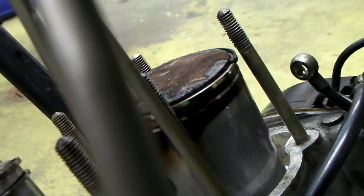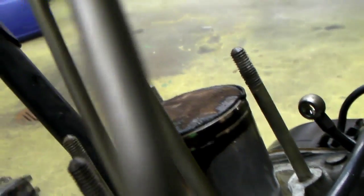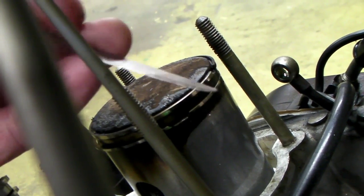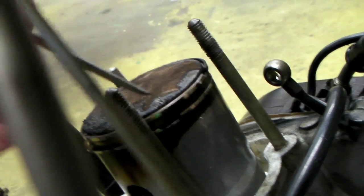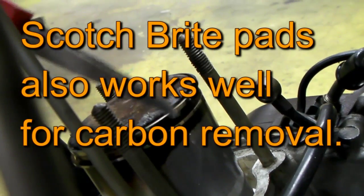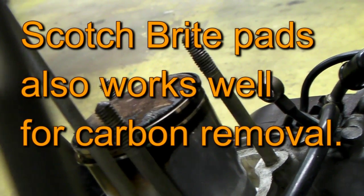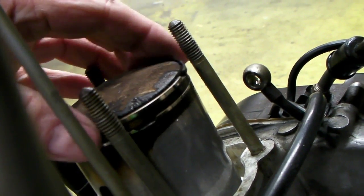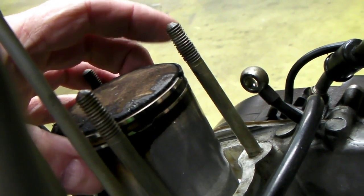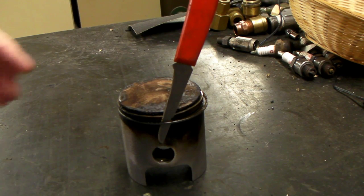It's real important to keep those rings so that they're free. If they're stuck, use something like a 6-inch scale, or like I say, an orange-opening knife — if it's soft steel, not heat-treated or anything like that, just a cheap little thin knife — and you can go around the inside and work that loose. If you can't get the ring out of the groove, sometimes it pays to heat the piston a little bit after soaking it in carburetor cleaner.